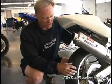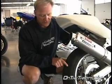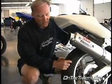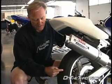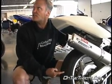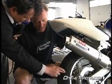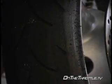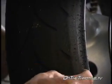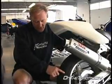So we know that the shock rebound-wise is actually pretty good because there's a small scalloped edge here. A hot tear will always have this clear band and then go into the center of the tire. Oh, the tear characteristic is going like this. Yeah, so this tire is gaining too much tire pressure, and it's actually tearing into the middle of the tire and melting the tire. As it melts, it's going to follow centrifugal force and go into the middle of the tire.